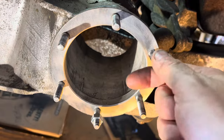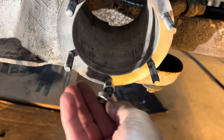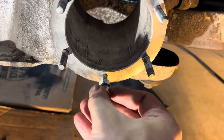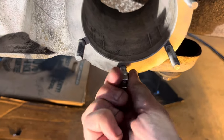After you've examined all these to make sure none are broken or messed up, loosen them all so you can remove them — it'll be easier to clean. What you do is double-nut this with some 5/16s or whatever nuts you have laying around, then once tight, back it off.